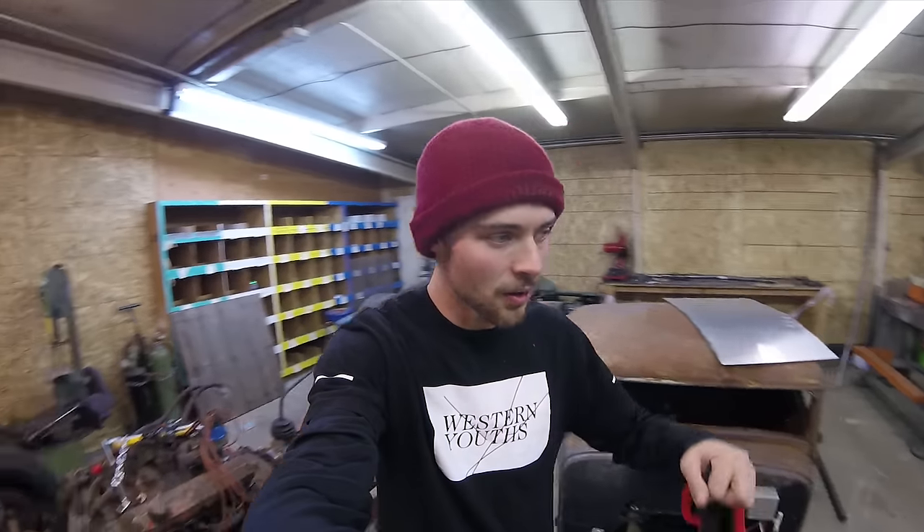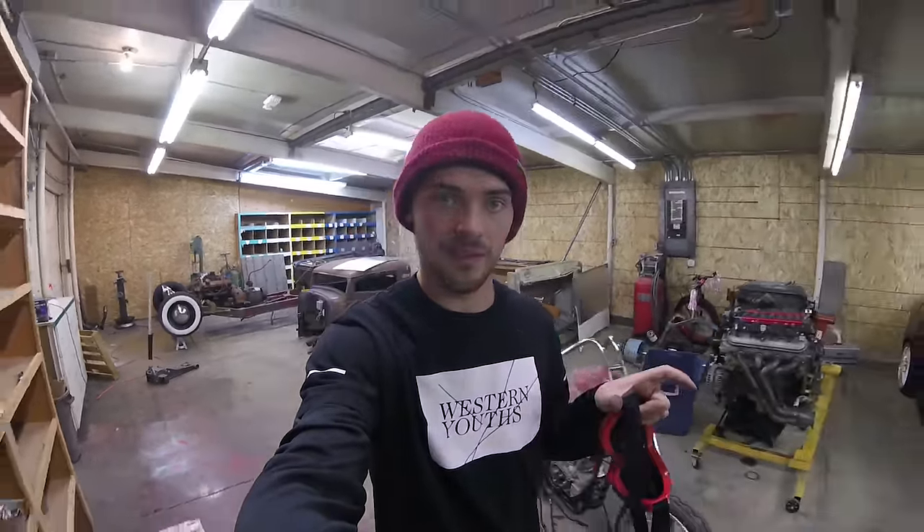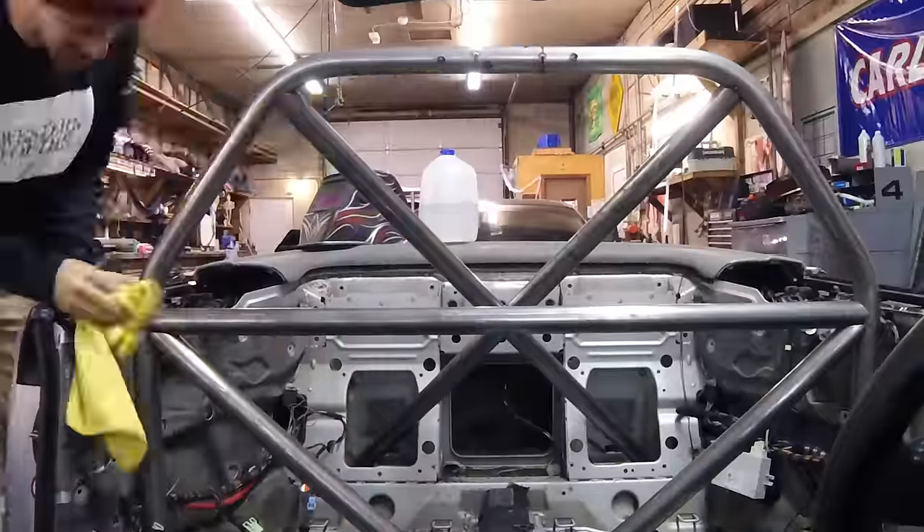We are in Garage 52. I brought the E46 here to get a roll cage in it — it's going to be totally custom and we're doing it right now. First thing I did was grind the areas where the cage was actually going to be welded into the car, while Russell made some templates for the brackets to weld the cage to. Then Russell went into the car and made measurements on where the roof goes up and down — because it's a convertible — just to make sure the cage isn't going to get in the way of the motion of the top. Then we bent the steel, we cut it, tacked it in place, and right now Russell's welding it all together. After today, all we should have to do is paint the thing.